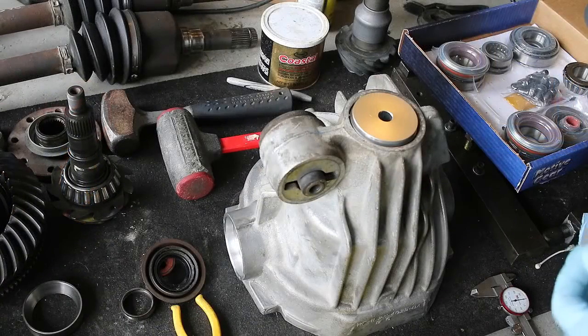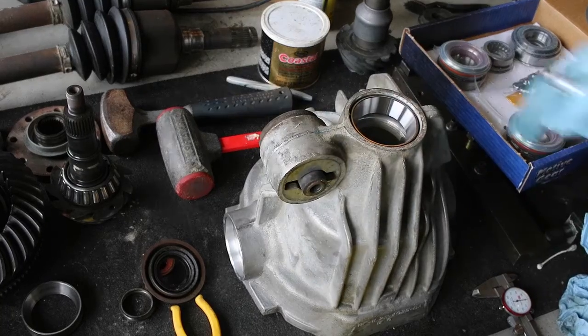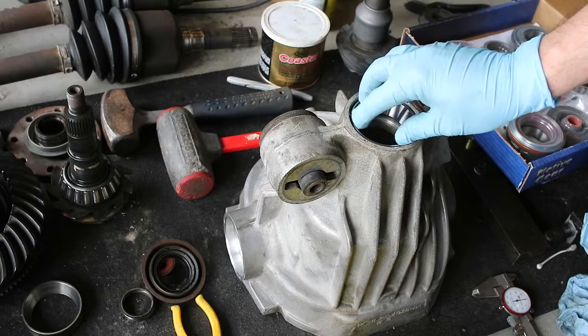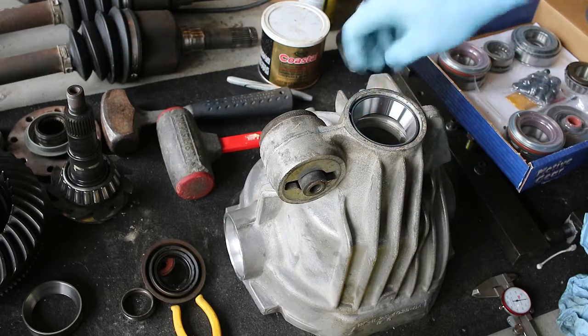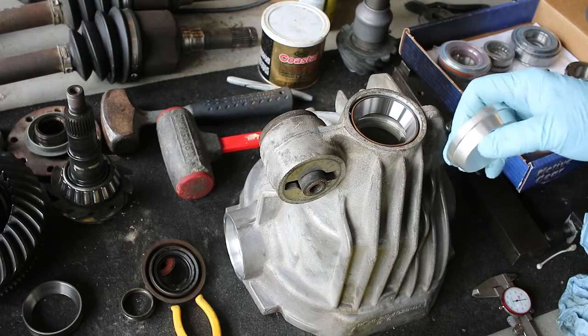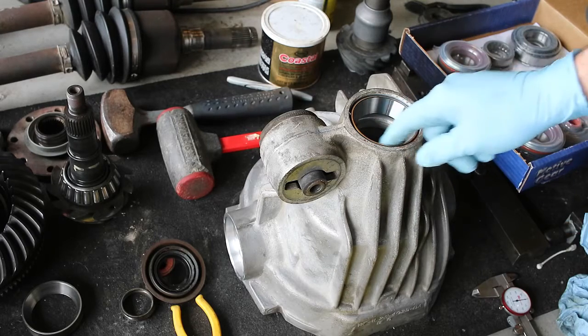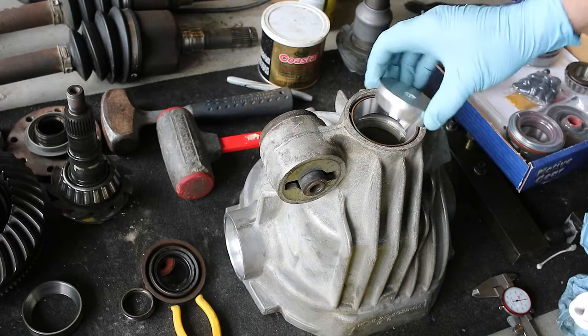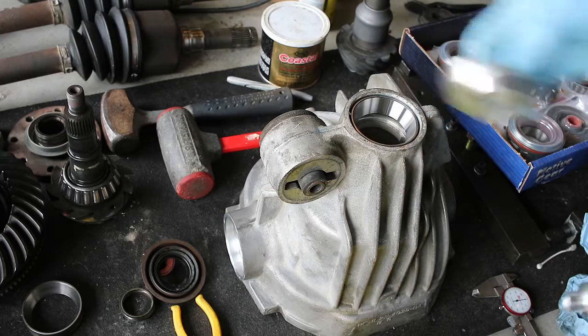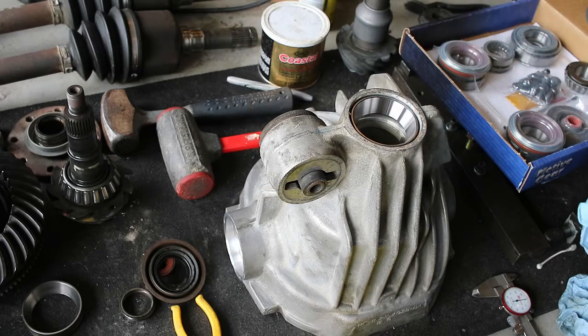Alright, so the first thing I want to do obviously is make sure I've got the right driver in my bearing driver. And we've gone ahead and cleaned up the bearing at this point. Made sure that the surfaces had all the oil removed, that it is the right bearing, and fits down in its housing, and it's squared up. These are machined aluminum, so it's a softer material than this bearing, and the bevel is not riding in the race. It's just kind of floating in there. We're driving down on the shoulder of the race. That's what's driving this.